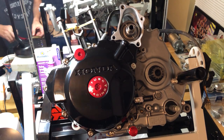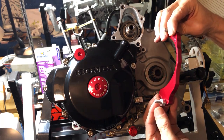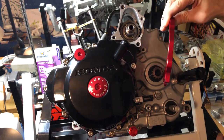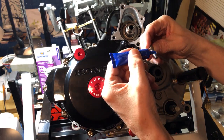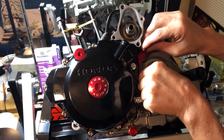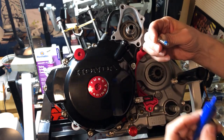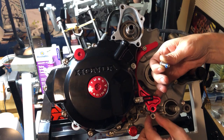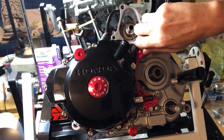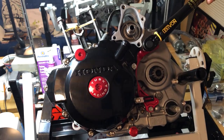For the case saver, we're using an aftermarket generic one with allen bolts and a raised sleeve on the bottom to clear the surrounding components. We'll blue loctite these — don't want the case saver coming off. Get the top one started, apply blue loctite, then the sleeve goes underneath. Torque to 88 inch-pounds.